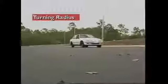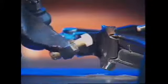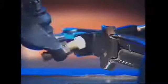This section examines turning radius. Turning radius is a measure of how small a circle the vehicle can turn around in when the steering wheel is turned to the limit. All vehicles have stops to limit how far the front wheels can turn. In some designs, these stops can be adjusted as part of a wheel alignment. If the stops are incorrectly adjusted, they could allow too large a turning angle and the steering box can be damaged.